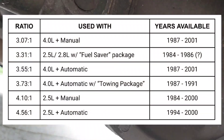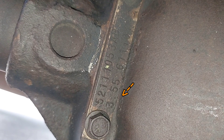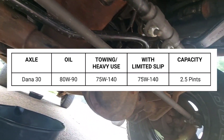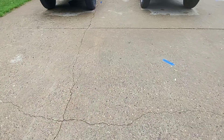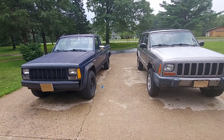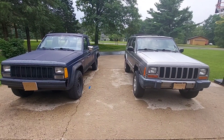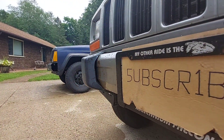I covered gear ratios in the rear axle video. In case you didn't see it, here's a table of commonly equipped stock ratios. You can also find your gear ratio by reading the tag on the differential cover. All Dana 30s request 80w90 gear oil from the factory, but differentials aren't very picky about what type of fluid you put in them. If you tow or actually have fun with your XJ, 75w140 is probably the best. All in all, the Dana 30 is a very respectable axle with a history dating to 1966, and it's actually still used today. It can handle up to about 33-inch tires when properly equipped, and I've never had any problem with any Dana 30s in any of my Jeeps — except the CAD thing on the MJ, I guess. Thank you all for watching, and I'll see you in the next one.